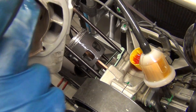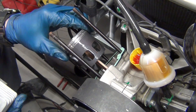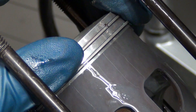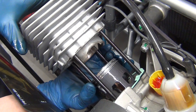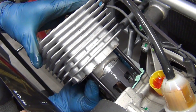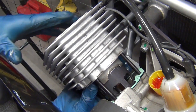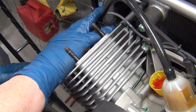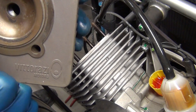Let's get this cylinder put on over the piston. With lots of lube on it, it's going to go great — without it, it'll fight you. You can see our piston rings are lined up on their little pins, facing the right way. When you push in with the pin at the top, everything lines up happy. Make sure that works on both rings. If you're experienced, you can lower it into the cylinder and use the prop to help push the piston up into the bore — just give it a little wiggle and voilà, we're in.